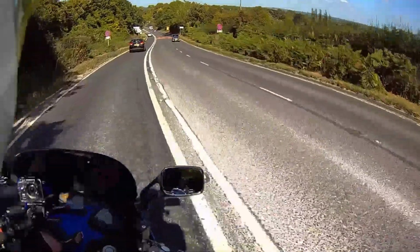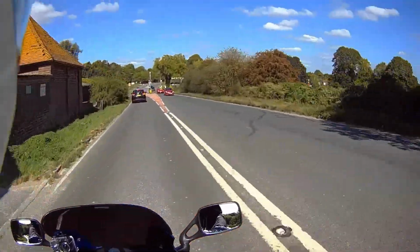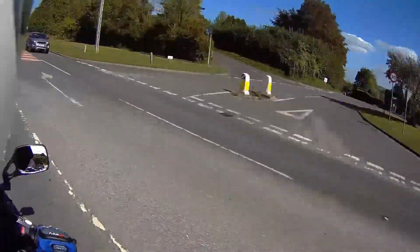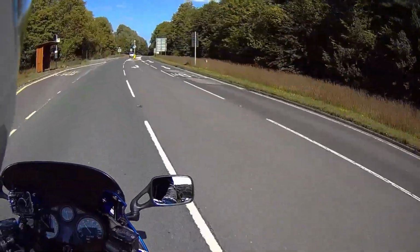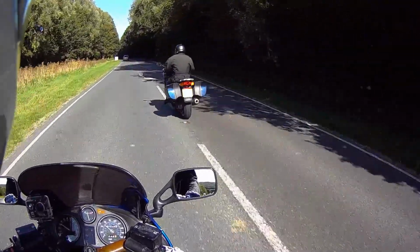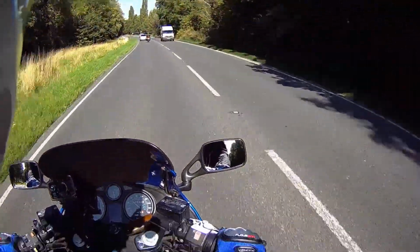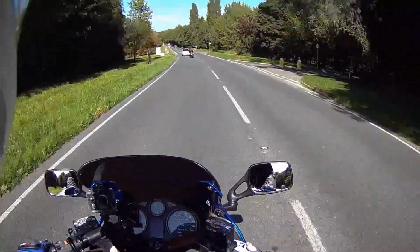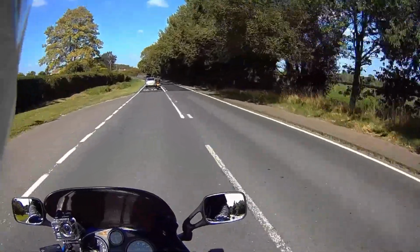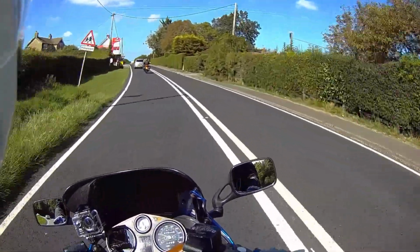you might be able to see this down there by the fairing stay, and there's one on the other side, a USB port. Now I don't like those there. I think they look silly, they don't stay in place, and it just means the wiring underneath the front fairing is even more messy. So I'm going to remove those USB ports, and I'm going to go for a socket that fits into the fairing panel on the right hand side, and that should tidy that wiring up as well. And I'm also thinking about installing a voltmeter on that panel, just to keep an eye on things.